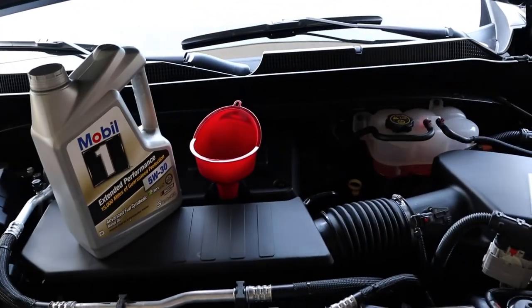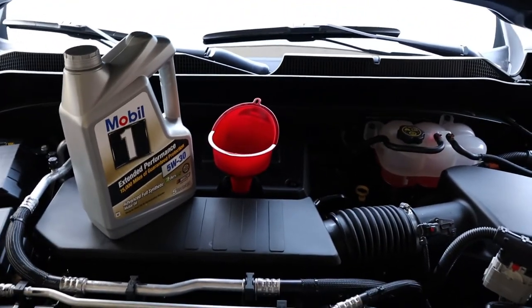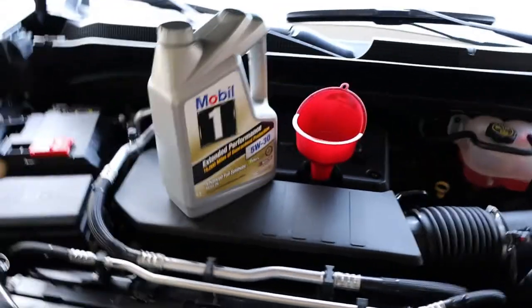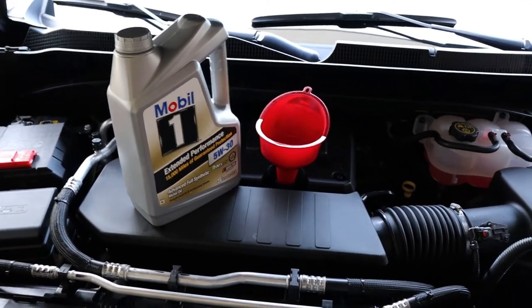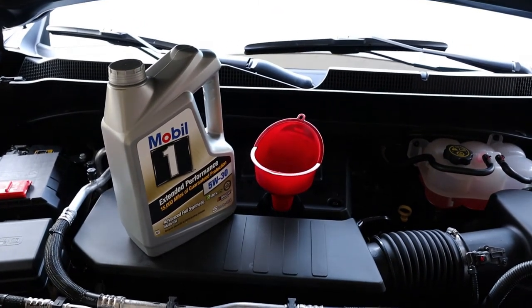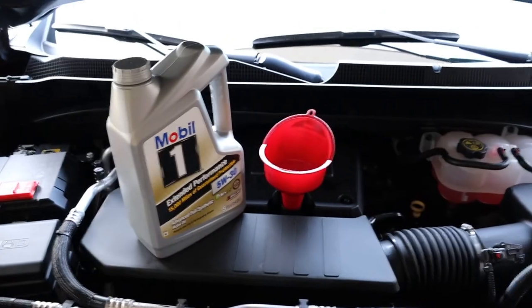Go inside and flip through the menu. All you have to do is scroll through where you see your oil life reset, hold down the OK button right there in the middle of the steering wheel, and your oil change is done. If you like this video, give it a thumbs up. Thanks for watching — don't forget to subscribe to my channel and like for more videos. Thanks again, have a good day.